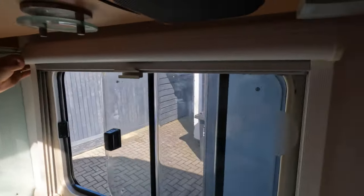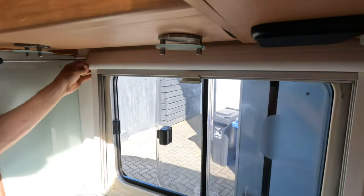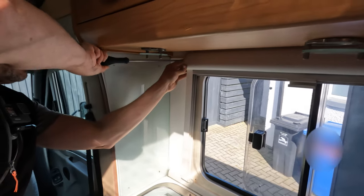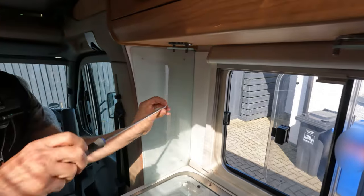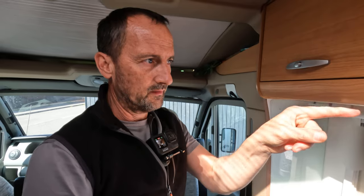Yeah, so the hole on this side had been previously fixed, in inverted commas, very well. It had pulled out slightly, so the original screws went in the wall about 12 mil. And they changed the screw for a different screw. So they put a self-tapper in there, which didn't really grip very well. Was it shorter as well? No, it was the same length. But it just didn't work because the self-tappers are narrower on the point.